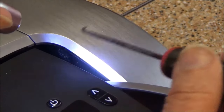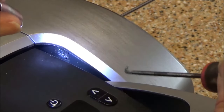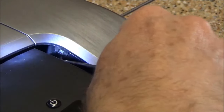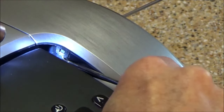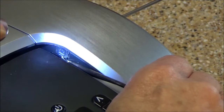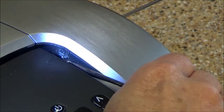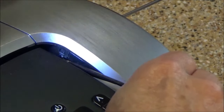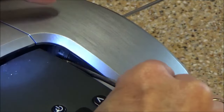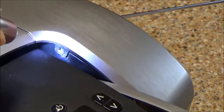There are two more latches along the front here, on this side and that side. We're not going to be able to do those just yet. We'll have to go back and do more latches toward the back. We have another latch on the interior corner on the right-hand side. I've raised up the K-cup arm slightly to give me the angle I need to get in there with the hook tool. I'll work the hook tool underneath the latch and simultaneously lift the cover up on my left-hand side to get enough leverage to pop it open — and it did pop open.